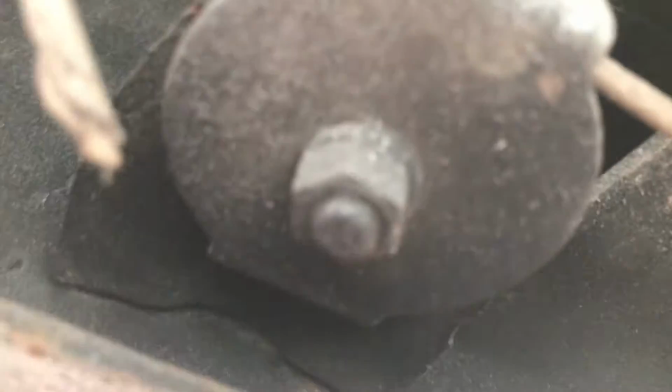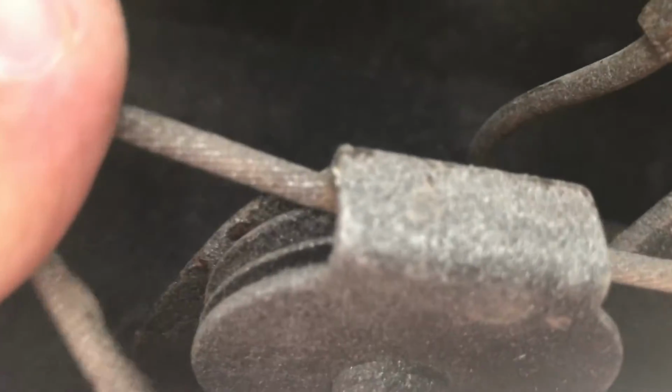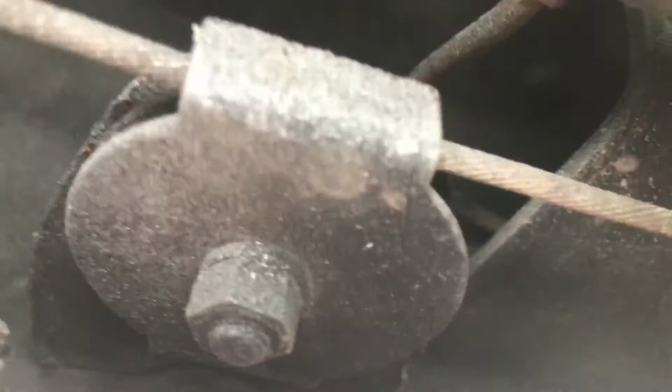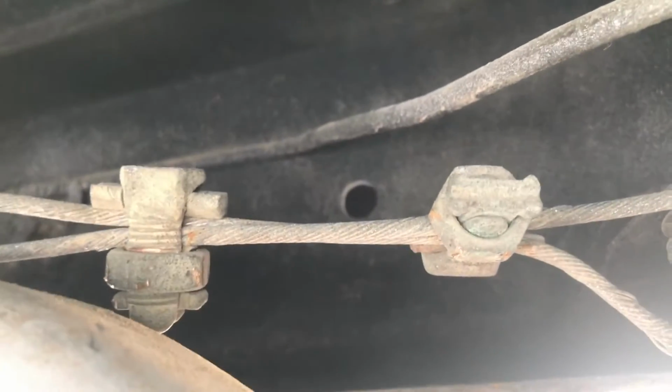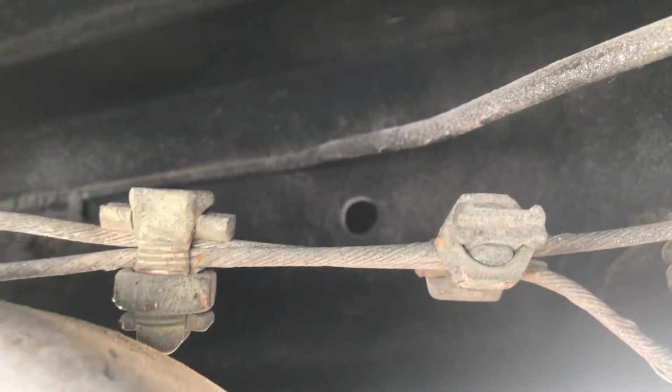is this wheel. The cable should go around this side instead of the way the last owner ran it through the wrong side of the wheel. By putting it through the wheel correctly, it'll tighten us up and it'll align the cable better to go through this hole in the frame, and get it behind the spring retainer for the regular brakes. So I'm going to take these two funky electrical cable ties off and reroute the cable around the back of the wheel, which should make this function a lot better.